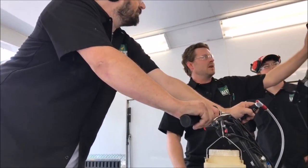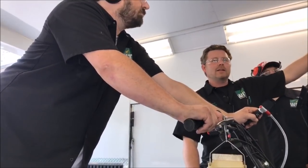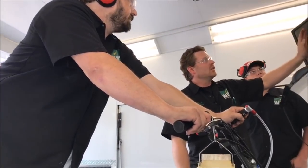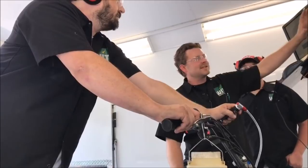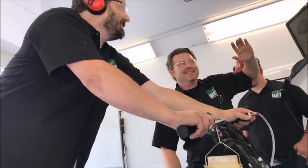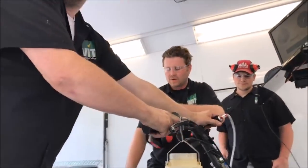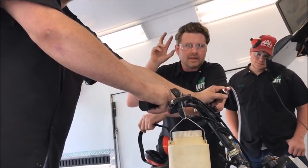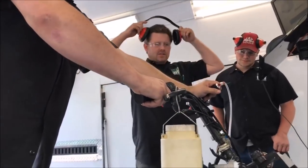With the automatic clutch, it pulls up to around 8,000 RPM then falls back to 7,000 where the clutch is maxed out. When it gets up to 8,000, he'll signal and the rider hits the button. They put the filter back on — they made a little more power without it, but put it back on to richen the mixture and be a bit safer.